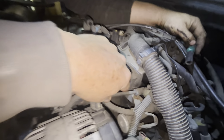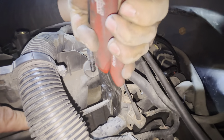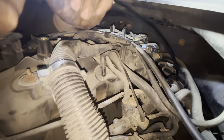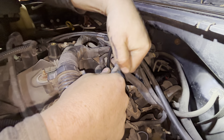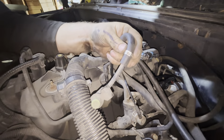Now we've got the return line, and now the vent line. This is the valve where the vent line connects. There's a green cap test port — if you want to cut behind that test port, use a knife to cut the nylon off the barb; the hose hooks into it with clamps already attached. On this one there's no barb on the test port, so slide it right over the old nylon and take a pair of side cutters and gently squeeze it to clamp it in place.